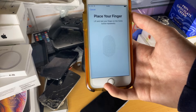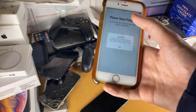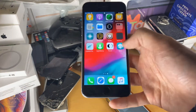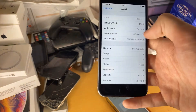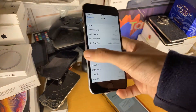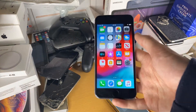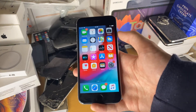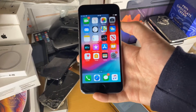Now, what if you bought the phone new? The solution depends on whether you have warranty. You can check by going to Settings > General > About — on newer iOS firmware it will say whether your warranty is active or expired. If it's not showing, you can contact Apple Support. There's an app in the App Store called Apple Support — download that, speak to Apple, and they will almost certainly take your phone in for repair and give you a free replacement home button.